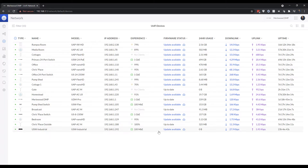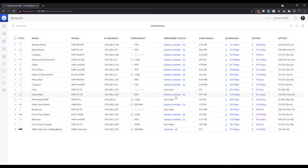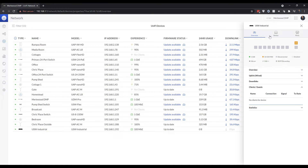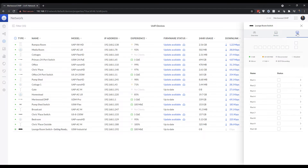The magic of editing did make that go a bit quicker. You can see there's also an update available, so we're updating the industrial switch to get it up to speed with the latest UniFi updates. Now it is ready to be used. So there are eight ports here — you can see eight gray squares because we haven't plugged anything in yet. There's also an orange square, which means it's running at 100 megabit. It should be a gigabit switch — I think I have a problem with cabling, but I'll sort that out later. Let's have a look at the device. I always give my devices names — this will be the lounge room switch because it's in the kids' lounge room. There's also settings here like jumbo frames and flow control — I don't actually know what those are, I should probably learn that.